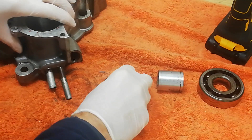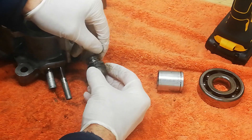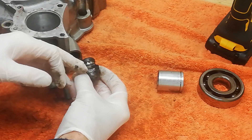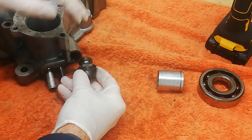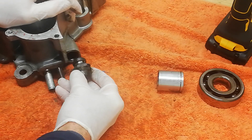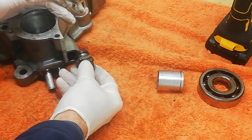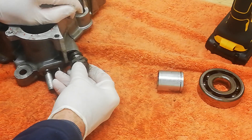That's the oil pressure release valve removed from the back of the case. Similar to the anti-drain valve, there's a big spring inside. If the oil pressure is too high, it opens the valve and allows oil to bypass the main bearings. Normally it's closed and all oil pressure goes to the main bearings, but at start-up — especially with thick oil — pressure can be very high, so this valve opens to avoid excess pressure.